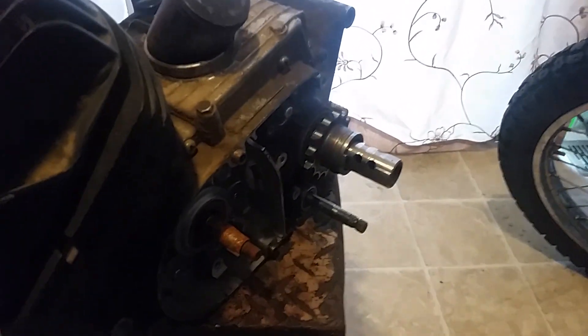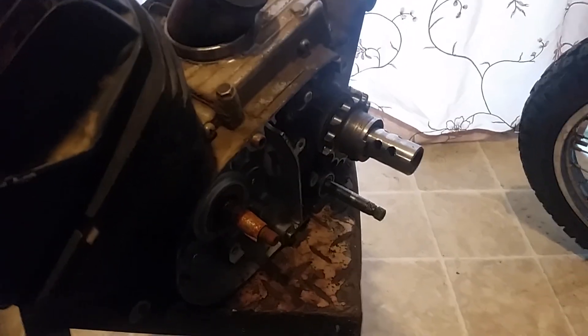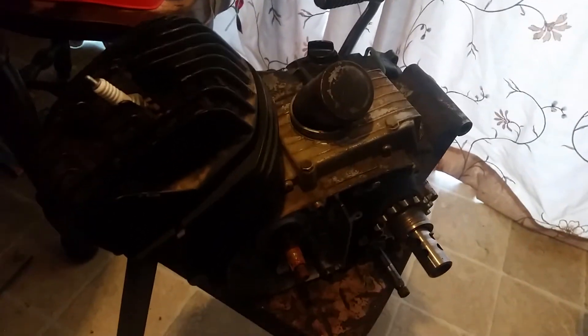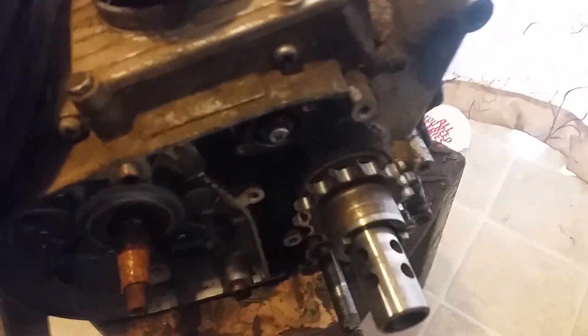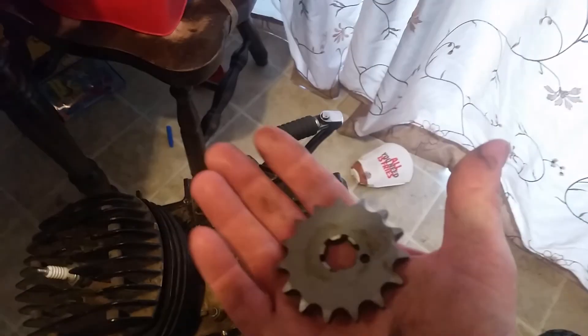It is not faster than your KE100. In fact, the high side is the same — it just has low gears for climbing and doing that sort of thing. Hell of a go-kart motor if that's what you were going to use it for. It's a pretty neat piece of history. It's a 15-tooth sprocket — same thing that the KE100s have for a final drive.